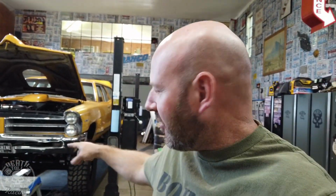I'm going to cut the knuckles off the front axle. We're going to rotate those so that we can get our pinion angle and our caster to go hand in hand. Right now I'm sacrificing on both. So we're going to fix that. Should have done it from the beginning, but it is what it is. So we're going to go ahead and do that now.